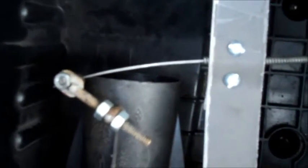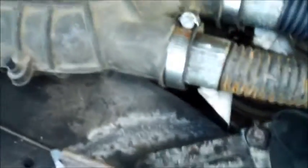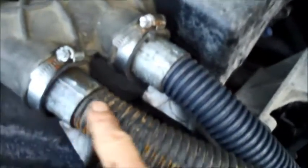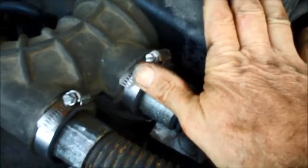I'm quite surprised it's working well. The modifications I made: this is the air filter where the air comes in from the outside, and all I did to modify this is to put a flat valve in here. This is controlled from the dash where I can move it back and forth to either shut off the air coming in or leave it wide open or somewhere in between. For some reason when they built this they had these two inlets — I cut out the rubber in it and it's a perfect fit for the sump pump hoses bringing the charcoal gas to this engine.